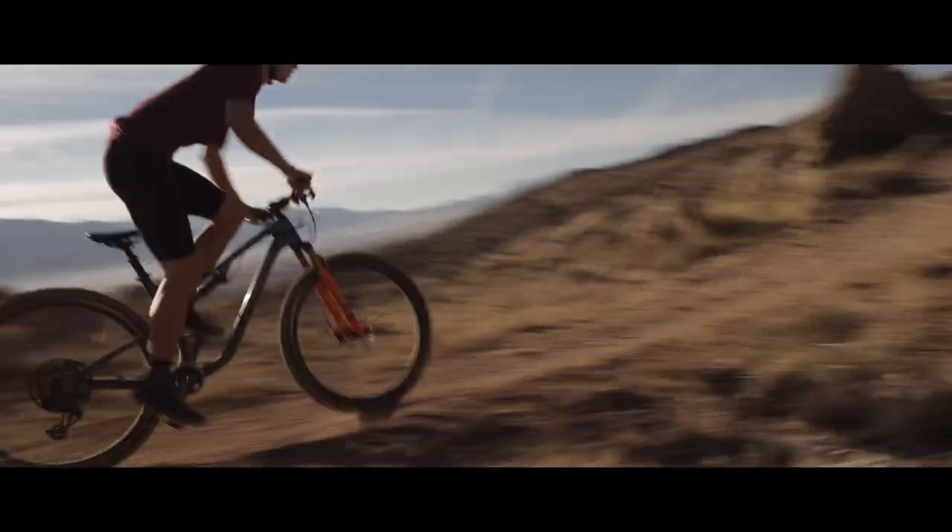The biggest thing I'm super proud of is what we achieved on the weight of the bike. When we start designing a bike, we write a list of priorities, and on the Signal Peak the weight of the frame was near the top. We wanted it very light, but we weren't willing to sacrifice durability. We were able to bring our SL frame weight down to 1860 grams — that's a pound and a half dropped over our current frame — achieved through layup processes as well as industrial design, slimming down the tube shapes and changing how things come together on the bike.